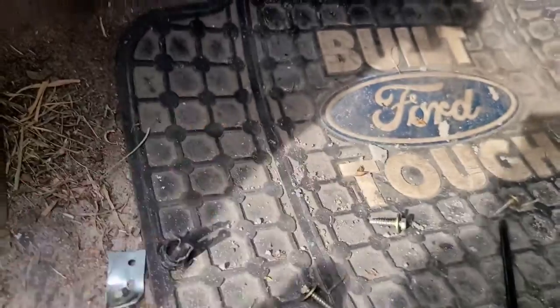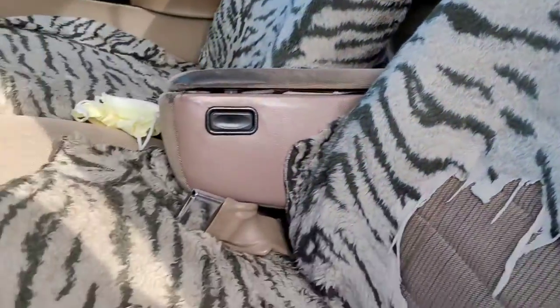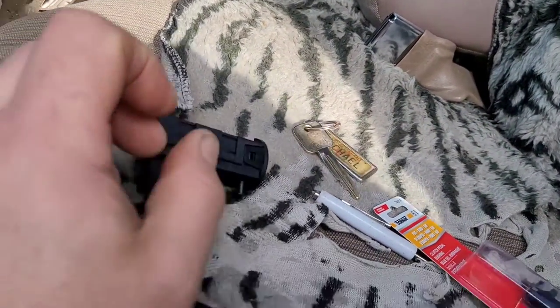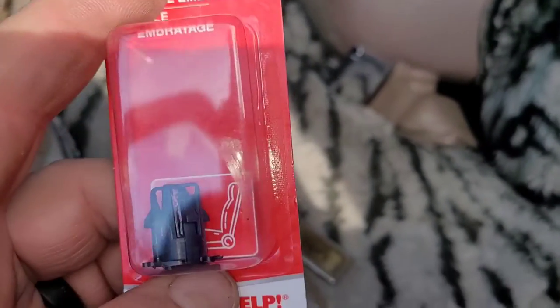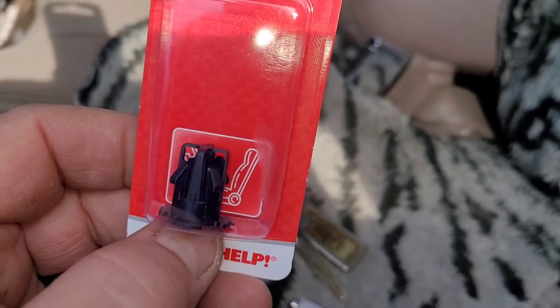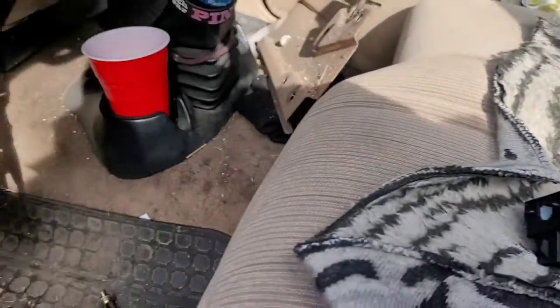So I'm actually going to replace the clutch switch, which I have right here — gotta love the seat covers. You have to disassemble it to install it. And I have a new Dorman 74014 clutch pedal bushing. I'm going to wind up installing that and hopefully get this back to the customer today so they can have the truck back.